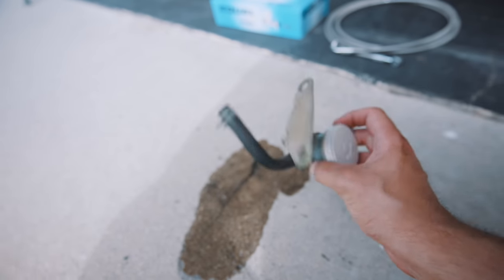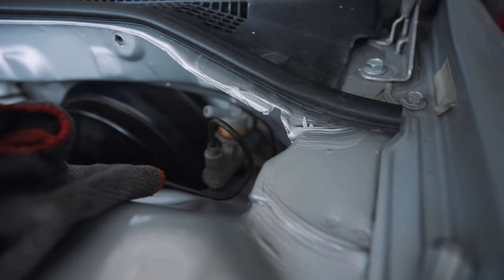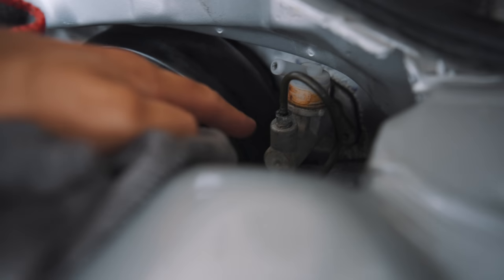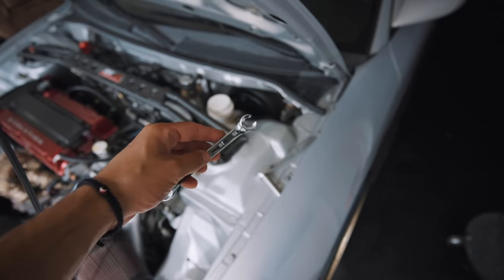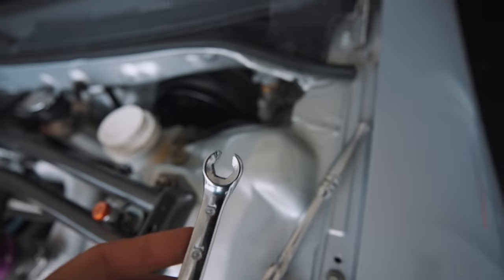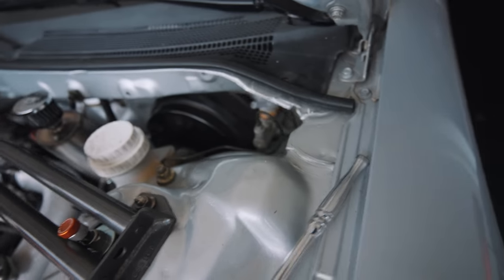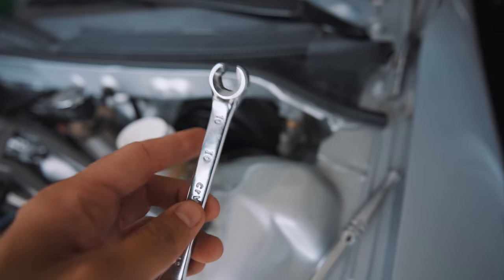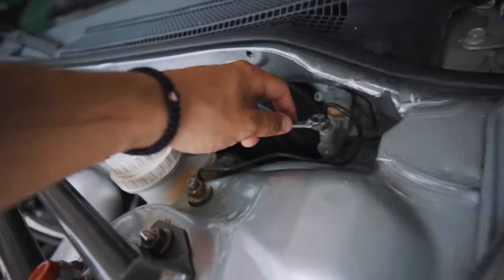This is the reservoir setup. After you're done with this, you come back in here. I'm going to dry everything up. We're pretty much ready to detach the hard line off of the clutch master cylinder right there. Based on what I saw, it's a 10mm wrench. I do recommend getting these flare wrenches just so you don't strip off the fitting, even though we're not going to reuse it — it's just a good habit to have. You can find these at hardware stores; I got them pretty cheap for the full set.